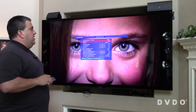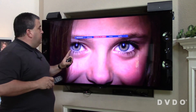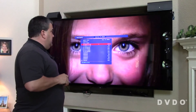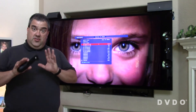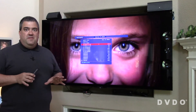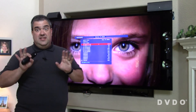A lot of that is covered in the user's manual. There's also a set of professional tools in two different menus. One of them lets you actually modify the reported capabilities of the TV — that's called EDID. We can capture and save it, and on-screen modify different parts of that EDID. If you don't know what this means or haven't done it before, be careful, because you can end up with no picture. If you modify it incorrectly, you can always do a factory default reset by holding both buttons on iScan Mini while you plug power in — that resets everything and gets your picture back.